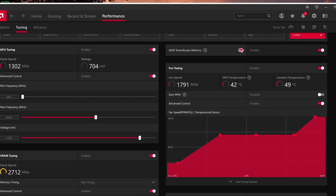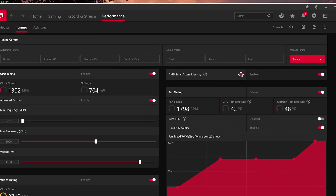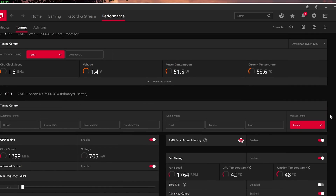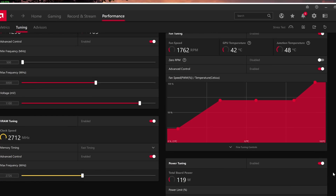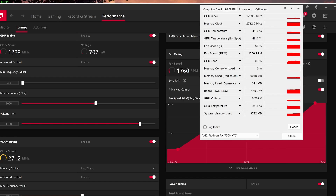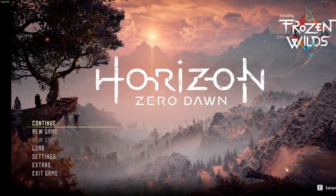For the max frequency you can mess around from 3000 to 3200 MHz; I ended up bumping mine back to make it stable, and 3000 was a sweet spot for me. For my undervolting, I actually ended up raising the voltage because the lower settings were giving me more crashes. For the VRAM tuning, I ended up raising it from 2560 to 2726. This was attempt number four — I'm skipping the other ones — and I have GPU-Z up to show its stability.